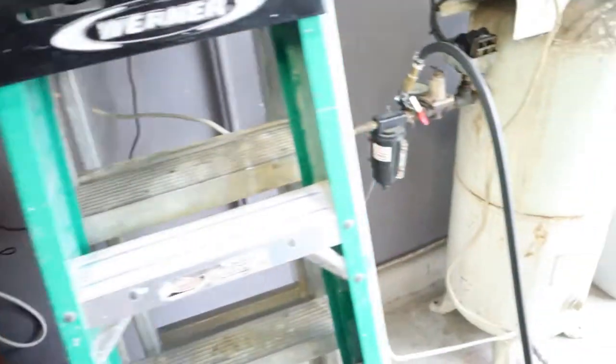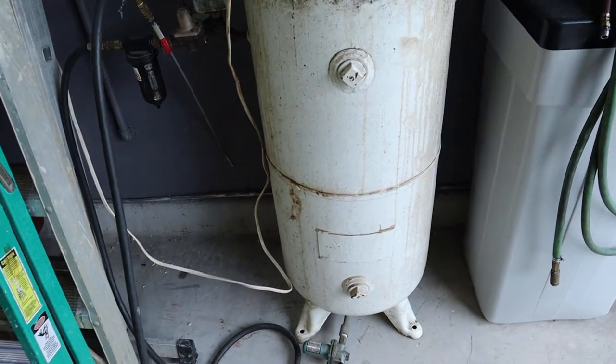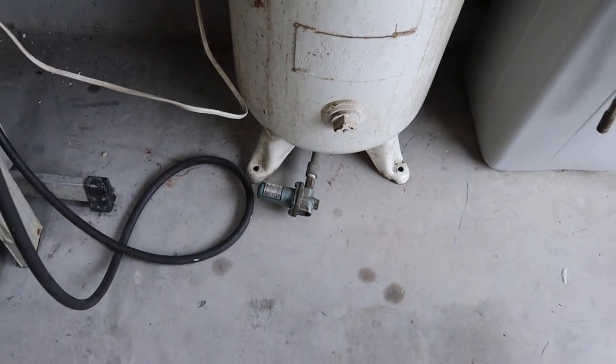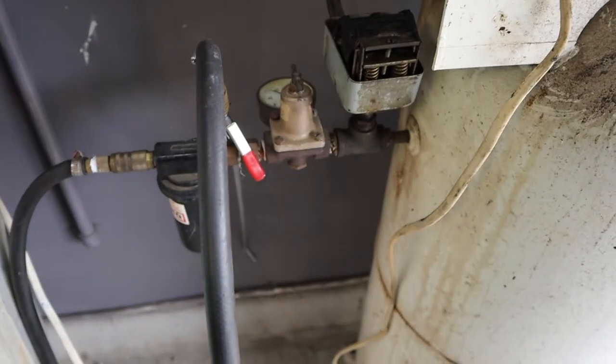The way I'm going to be doing it today, we're going to be using the air compressor — shop grade style. What I usually do before I go off and get the compressor charged up: there's a valve down there. If you have something similar at home, it's a good idea to go ahead and get that drained out before you charge the compressor. It keeps all the water out of the airlines.